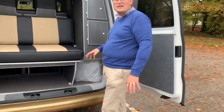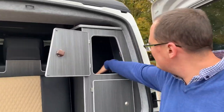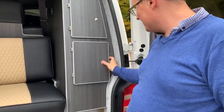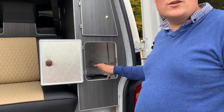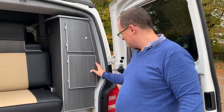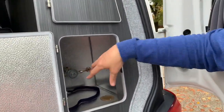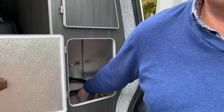The other thing you've got in the back is a bit of storage - you've got a cupboard in there and you could probably get quite a bit in that cupboard. Just moving down, you've then got your gas safe cupboard, so you should only really store your gas bottle in there. Any professional conversion should have what they call drop vents, so that if the gas leaks - because the gas sinks - it will go down those vents and out of the van so it doesn't gas you.